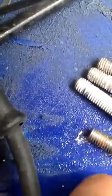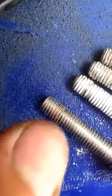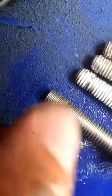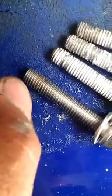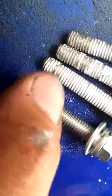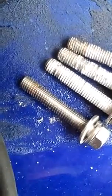All right, so here's the 3 bolts that came out of this ski. Here's a 4th one that I have broken. But see all the gunk on those bolts? And this one came out of another ski, but it had Loctite on it right there. So what we've got to do is clean all these off with the wire brush and put a little dab of red Loctite at the bottom. It's showing put Loctite, so I'm going to put it. All these have it. I can see red on the bottom of all these, so I'm going to clean these up on the wire wheel, and we're going to put a little Loctite on them, and then they go right in this top plate here. So that's my next move.